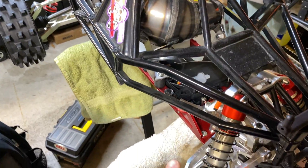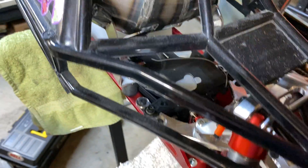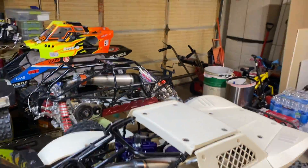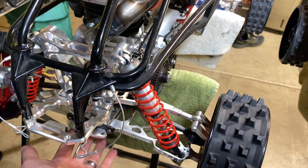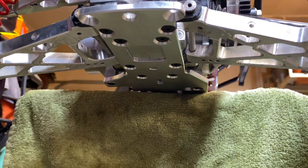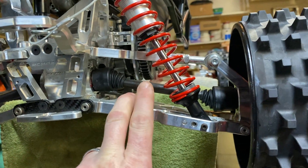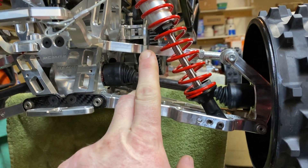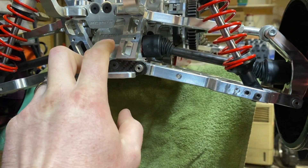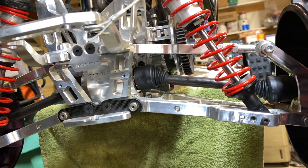I basically gutted the whole thing. It had symmetrical steering — I got rid of that and put in the heavy duty turtle servo saver. I put in a new steering servo. When I got it, it had a Bonehead rear chassis brace, but I went with the Modified RC one instead. This Baja is very similar to my 46 Baja, just with a 65 Supreme instead of a 46 GT. It's also got all the RC Max locker black bone gears and all the bells and whistles.